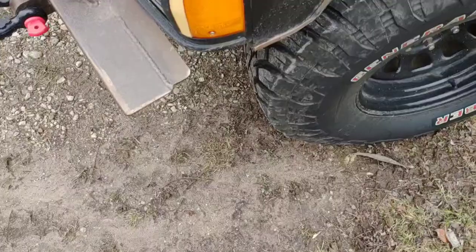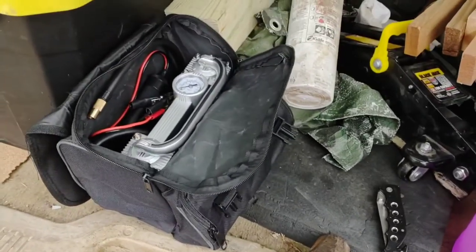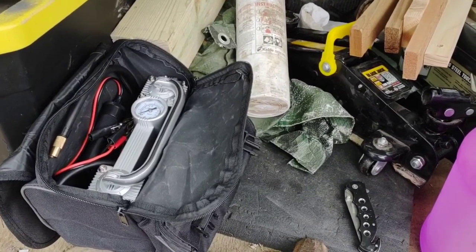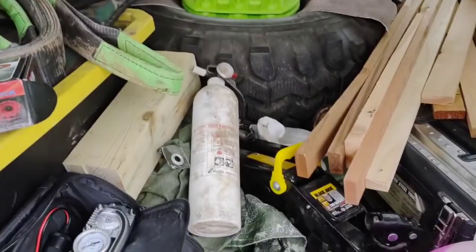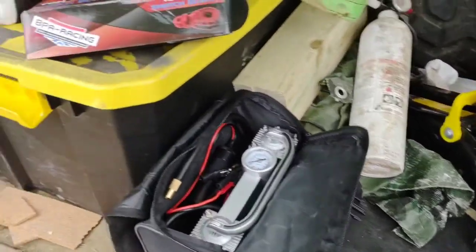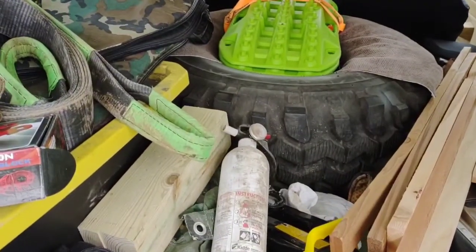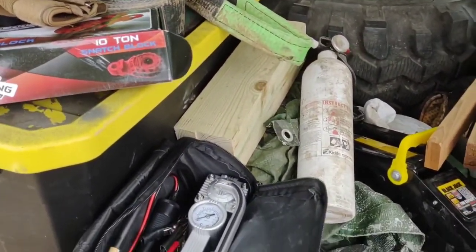More tie points. When I put all this stuff on I added up the weight — even the tires, because they're probably 80 to 100 pounds apiece. Every time you upgrade and put extra weight on your vehicle, this is no longer a 3,000-pound vehicle. The rear cargo area on this thing is only supposed to carry like 600 pounds, maybe 800 with passengers. I've got it set up as a two-seater. You add up all this extra weight — bumpers, tires — that 33-inch swamper right there is probably 100 pounds — and I'm still under the factory specs.